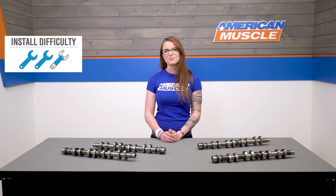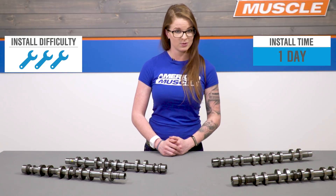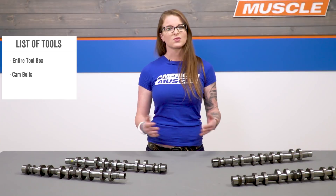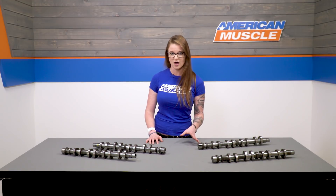When it comes to the install, a cam swap is gonna be a fair amount of work — we'll call it a three out of three wrenches on the difficulty meter. You can plan on spending anywhere from a half a day to a full day in the garage, depending on your expertise and experience. You need your whole toolbox for this one, and I would get some new cam bolts for the install. If you're planning on doing this yourself, a manual with the torque specs would be a great place to start. You'll need to remove the intake manifold, valve covers, crank pulley, front engine cover, and timing chains, just to name a few things before getting started with the actual swap. If this is something you're not up to speed on, you might wanna leave this one up to your local shop. And don't forget about those other supporting mods that you're gonna need to install with these cams.